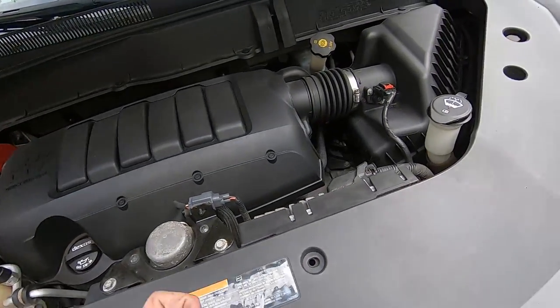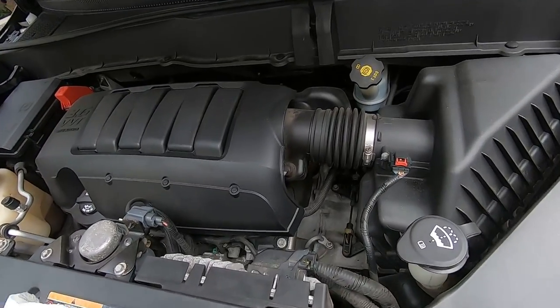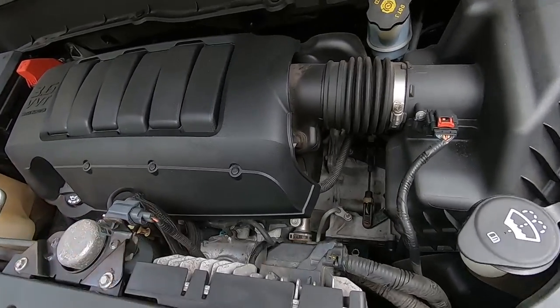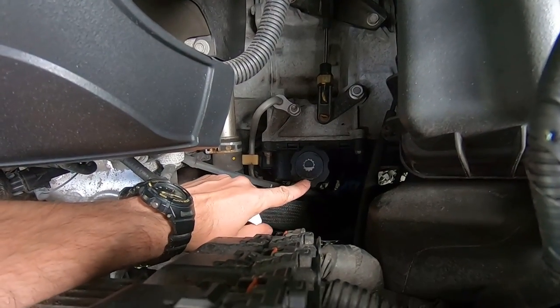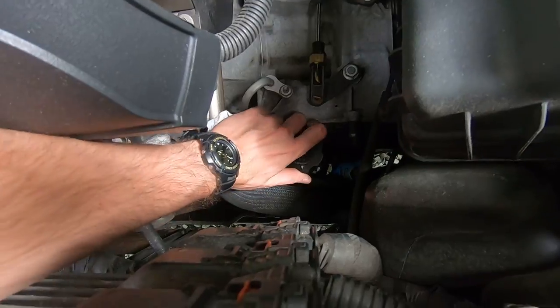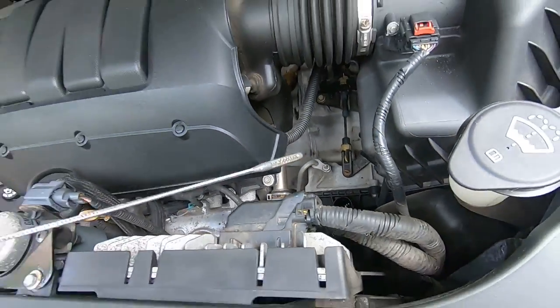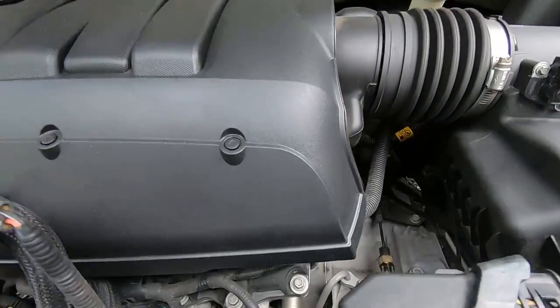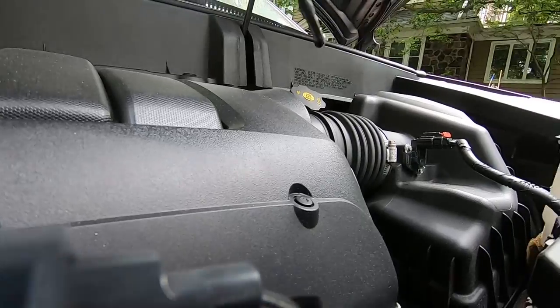Transmission. Transmission should also be checked either on a working or hot transmission. Here is our transmission cap — that's actually a cap here, we have to unscrew it and then just pull it out. We have the same dipstick like the engine, pretty much the same thing, just transmission — and the oil should be red in color.